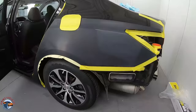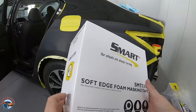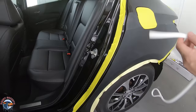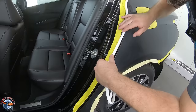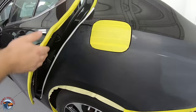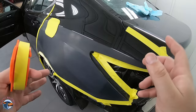The key to pulling off this job is having some soft edge foam masking tape. You can use regular tape and fold it back, but this works so much more consistently. I went ahead with a 13 millimeter - I prefer the smaller masking tape for this. The first place I'll use it is here in the door jamb where we want a nice soft edge. Essentially we're doing the same thing here that we're doing on the body line - we're creating a soft transition for our clear coat to meet. Pay attention to how I'm masking it because this will make or break a job.